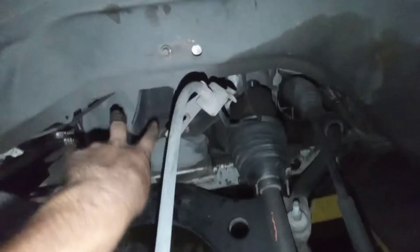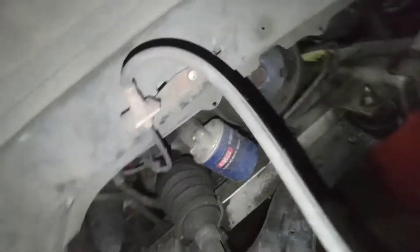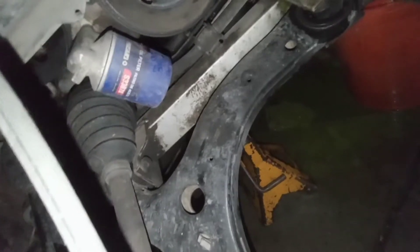Made a lot more progress — I've got this axle out, got the strut out on both sides. I've got the top two bolts out of the transmission mount bracket so I can get to the other two with the impact and a socket and it'll just zip right out. This side's ready — I just have to get the trans cooler lines undone. On the other side the strut is out and I just need to get that axle popped out and she's pretty much ready to come out.